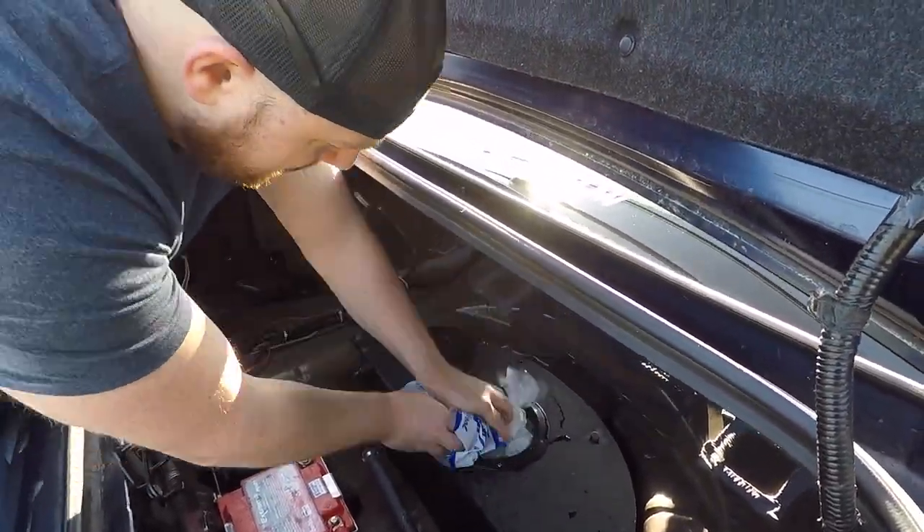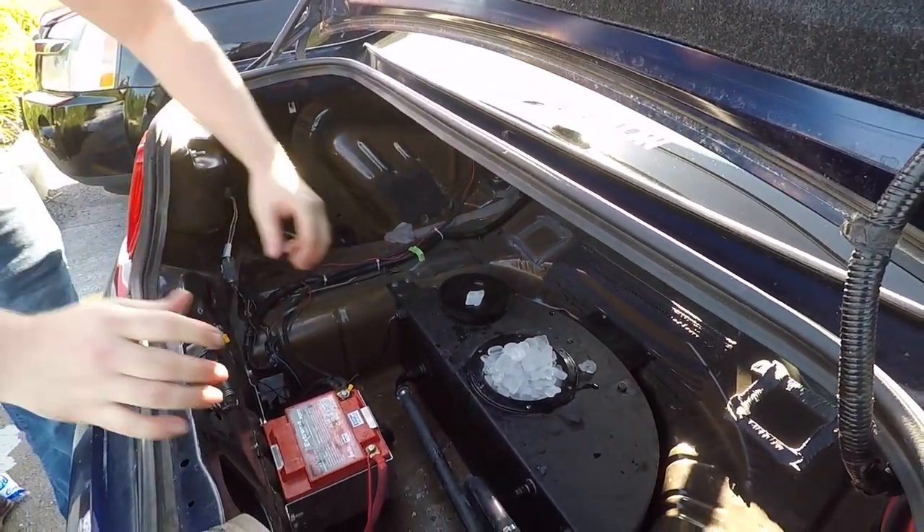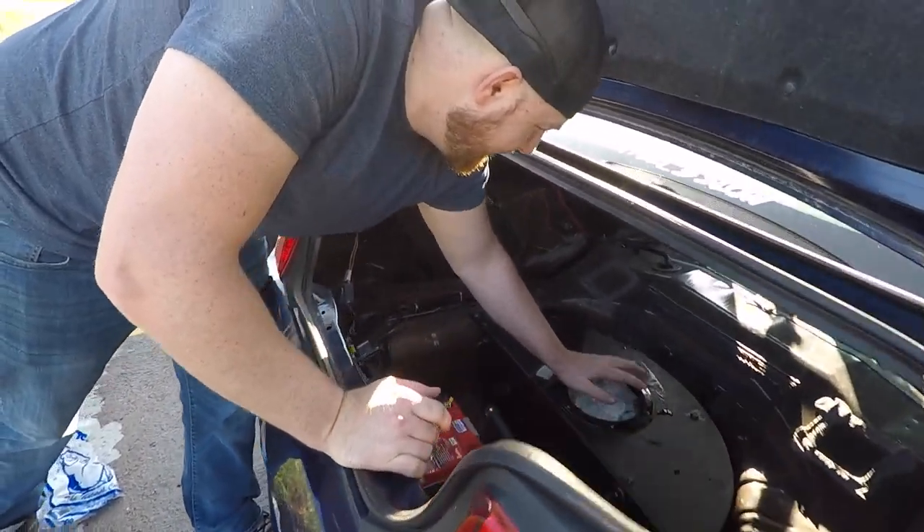There he is — we just put ice in it. You get super cool temps, so there are pros and cons. With ice in it, temps will go down to the 50s or 60s on the dyno. Another little tip: usually every 10 degrees of air temp is between 1 to 1.5% power. So knocking down 50 degrees off that intake charge means 5 to 7.5% power — we're looking at almost 50 extra horsepower from that alone.